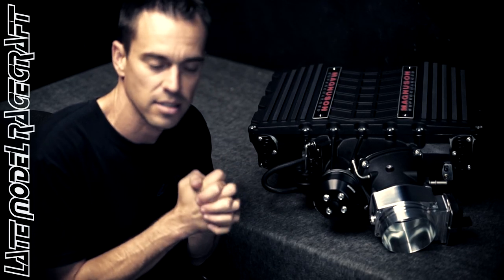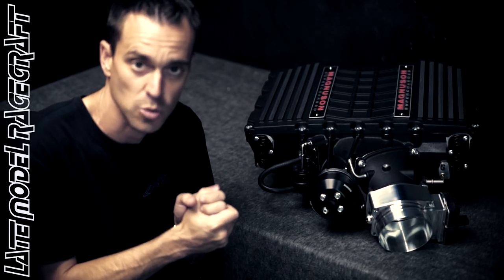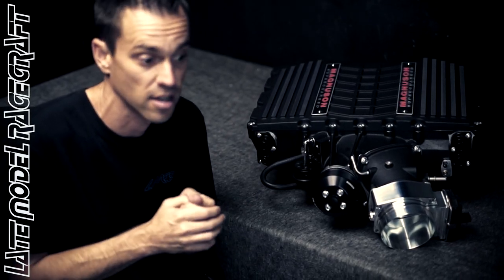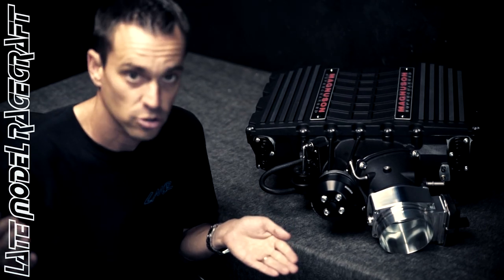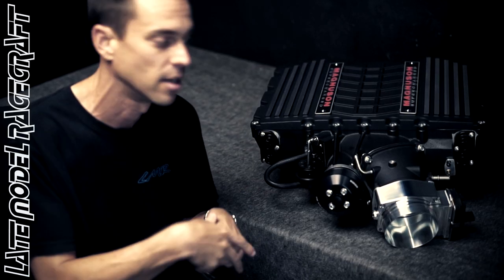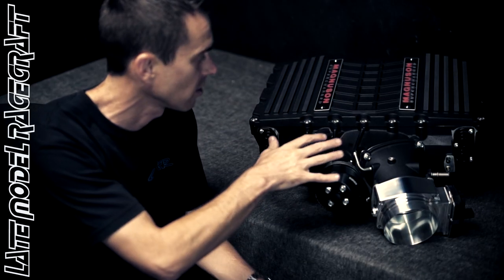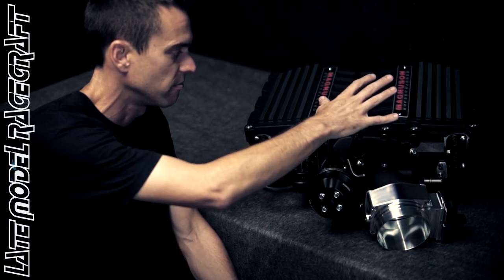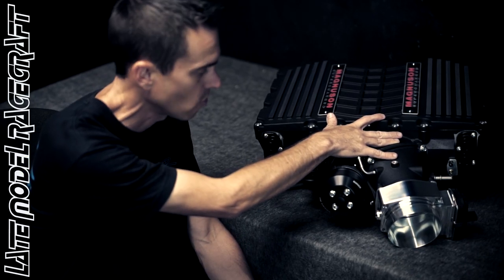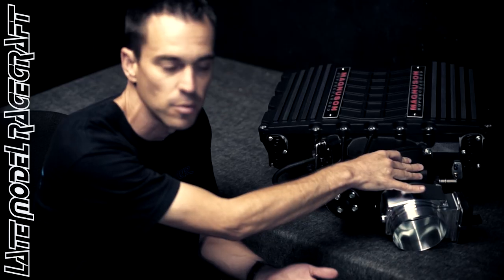If you want more than that, the 2650 has big enough rotors to spin harder and give us 15, 20, even 24 pounds of boost depending on how efficient the engine is when it comes to camshaft, cylinder head, air box, and exhaust. In this particular situation, you can run an LT1 or LT4 with the 2650 supercharger with a factory 87mm throttle body, and for most applications a 150 rear wheel horsepower gain is very easy to do.